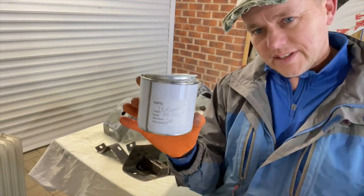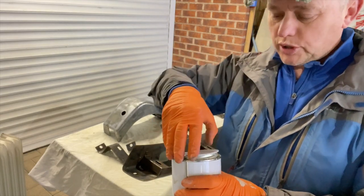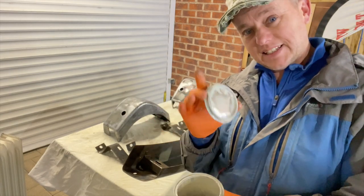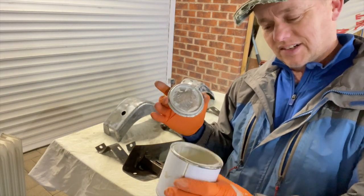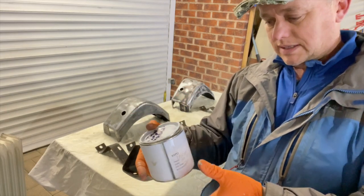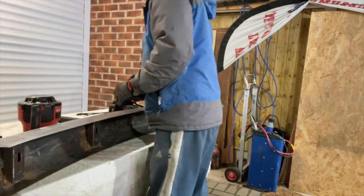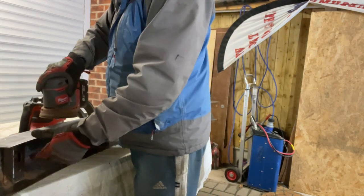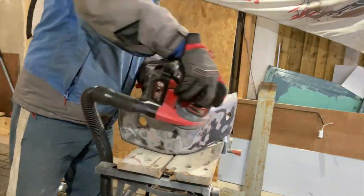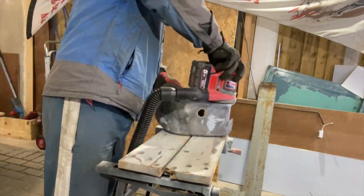I've just got in the cupboard this paint that I mixed up with the thinners and hardener two days ago, and it looks like it's gone to jelly. Yesterday it was okay — I managed to do a bit with it — but today it's finished. So you get a bit of time once you've put the hardener in a concealed container; if it was open it would go off a lot quicker, but in the sealed tin it gave us two days. We'll just get the Milwaukee hoover on here, attached to the sander, because this is filler dust and I don't want to fill the carport with it since we're painting here soon. It's worked a treat — I can get these smoothed right off really nicely, ready for some primer.